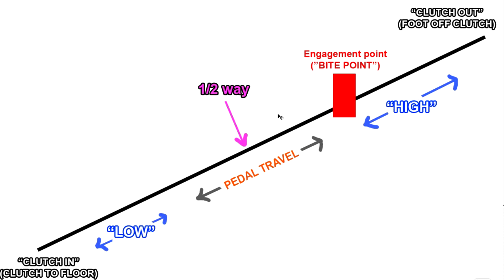Now you watch that video where the person gave gas and brought up their clutch and went. Now you've gone to the hill to try it. You're sitting on the hill, you take your foot off the brake. You're giving gas, you're giving gas, all this time your car is rolling back and you are waiting for the clutch bite point, the clutch to engage and your car to start to roll. Since your engagement point is up here, you've got to wait all this distance before your clutch engages, even though you're giving gas just like the person in the video.